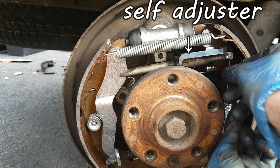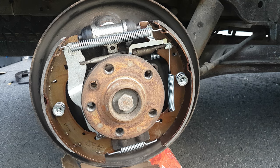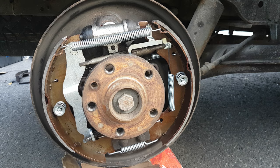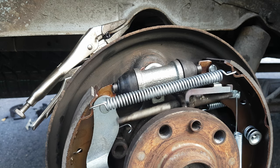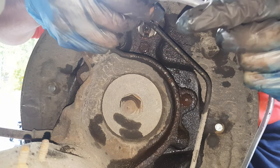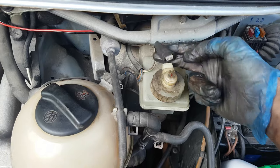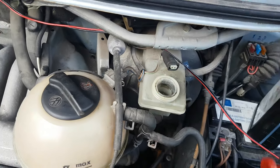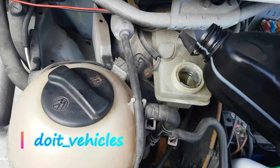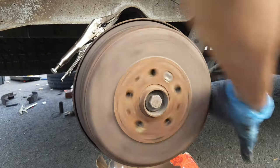After the new shoes are on, you can manually adjust them with a screwdriver from behind. Test the handbrake and the brake pedal — you can also see the self-adjust clamp engaging. Finally, bleed the brake lines by connecting a tube to the bleeding valve and pressing the pedal until all the air has come out. Meanwhile fill up the reservoir with brake fluid and keep it full during the bleeding process to avoid more air going into the lines. Alright guys, that was it — thanks for watching and I will see you in the next video.